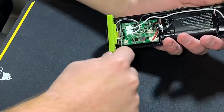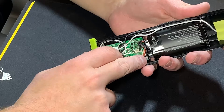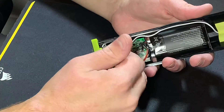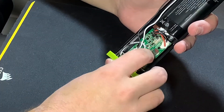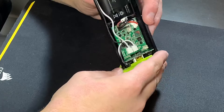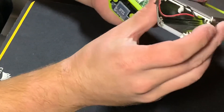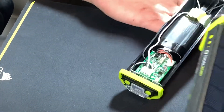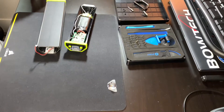As for the board, we've got our solar panel, two temperature sensors, our two lights, our battery, and our button board. The charging board is mounted 90 degrees to the main board, which has all the boost circuitry and protection circuitry on it. It looks pretty simple, honestly. They have coated this board in a waterproof coating, which is obviously important since this has an IP67 waterproof rating. I'm guessing the rubber seal pushes up against the aluminum tube and they coated the board just in case, because sometimes things can be a little sketchy during manufacture.